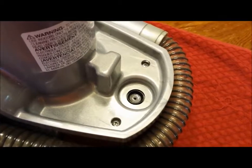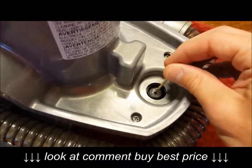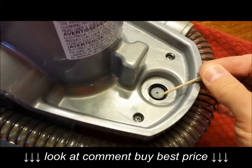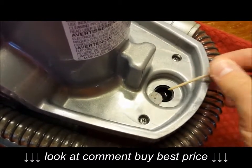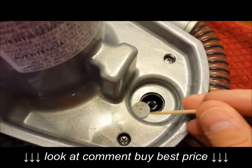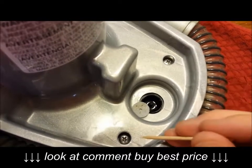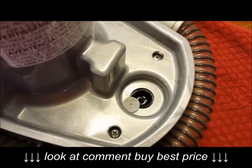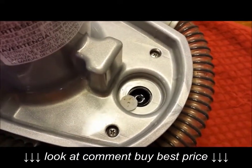The solution bucket sits in this plastic chamber. This part has a little sponge that can be popped out so you can check for debris, because the hole the solution has to go through is very small. Look at this, maybe clean it, and see if the hole is gunked up — solution can get very sticky if it sits for a long time. If this is free and clear, move on to the next step.